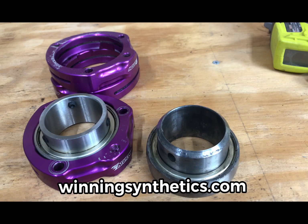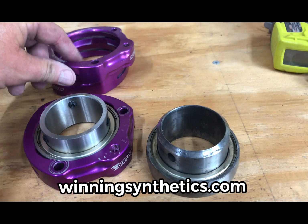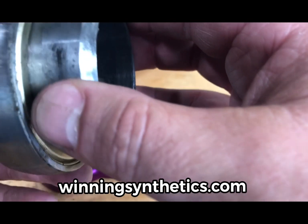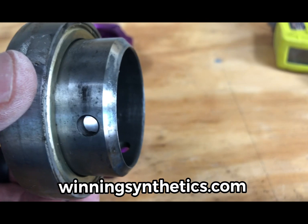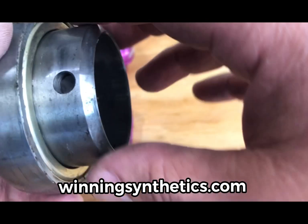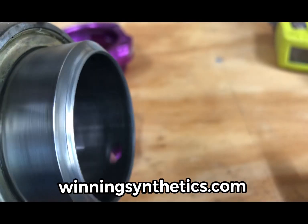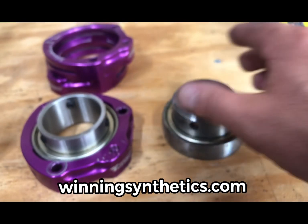All right, gang, so here's where we are as we wrap up today's activities. The goal was to get the rear axle reinstalled with the brake caliper on it and the lines all hooked in and everything good to go. However, after cleaning up the other two cassettes and the bearings, I gave those a really good listen, and well, I'll let you guys decide. I'm trying to wait till the traffic backs down out there on the road. Here, listen to this. That to me just does not sound like a good bearing.